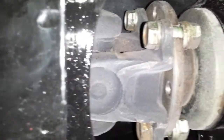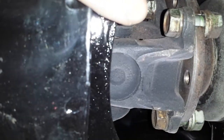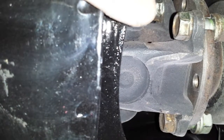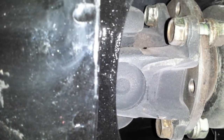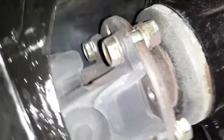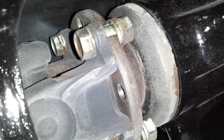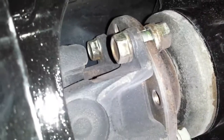So this is the Mark III shaft, or yoke on the end as well, flange I should say, with the Mark III bigger, fully serviceable U-joints, unlike the stock Mark II ones, which are not, and are way smaller too. We didn't want to run them for both those reasons. Simple solution: re-drill the flange on the Mark II diff. You can see how those bolts fit.